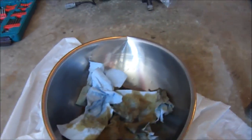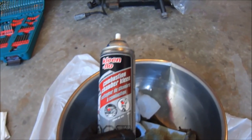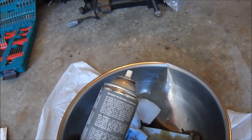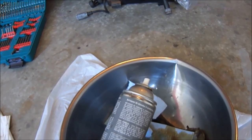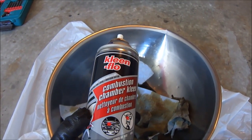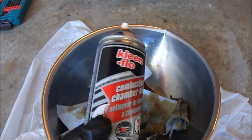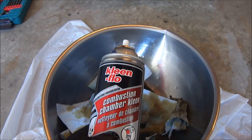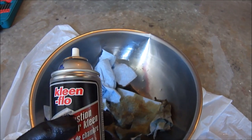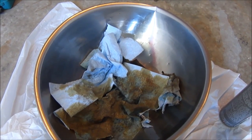What I did for cleaning it all out — I had a bucket here so I didn't spray the stuff all over the place because it's nasty. This is combustion chamber cleaner, but you can get throttle body cleaner — almost the same content, but this stuff is a little nastier. Don't spray it directly while it's sitting on the car. Take the throttle body off the car and then spray it. If you're going to clean your throttle body while it's on the car, make sure you disconnect it and only spray this stuff on a rag. Don't spray it directly into the chamber — it'll mess up your car, thin out your oil. This stuff is really good and cleans a lot out, but it could mess up things too. Make sure you work in a well-ventilated area — this stuff is not that great for your health.